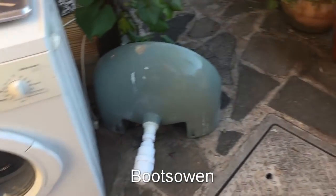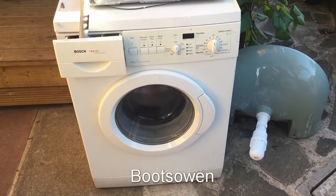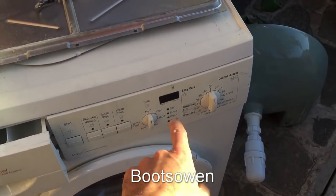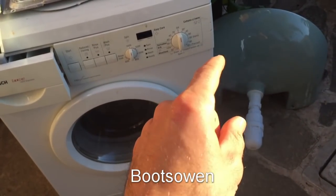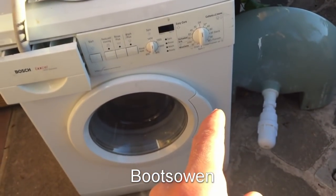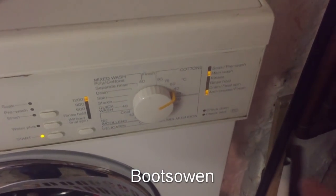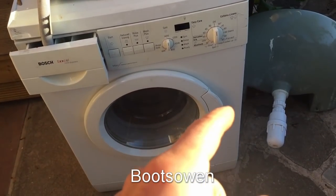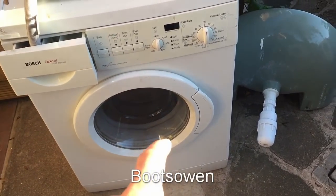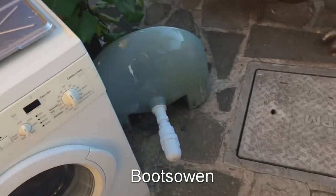Yeah, so it's 5 machines. 1, 2, 3, 4, 5, and then in the cellar is the Miele, and the Miele's out of service again because it's got this lamp that flashes instead of having an error code, because there's no kind of number thing on it. It's got lights, and so whenever the cycle is finished, if it gets to the end, the main wash light flashes. It's come to the end of a cycle. Looks like it's got a problem. The Miele Novotronic W864, I think that one is. The light flashes, the main wash light as well as the end light being on solid. Because that light flashes, it means there's an error, and I traced the error to the element, and the element in those Mieles cost a fortune, so I don't really want to fix that.